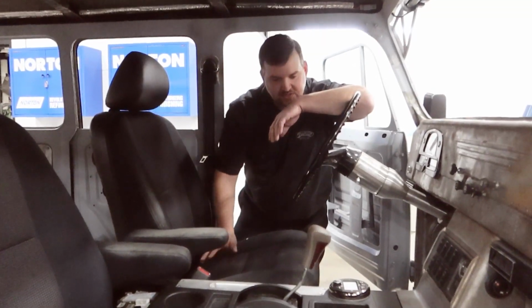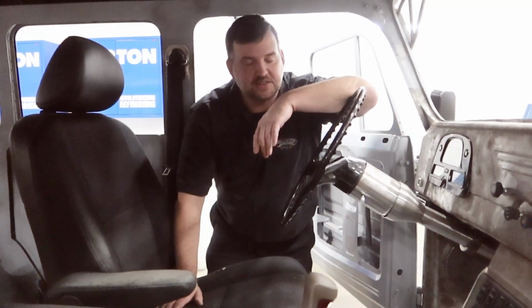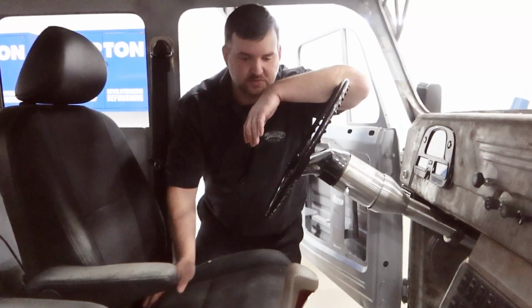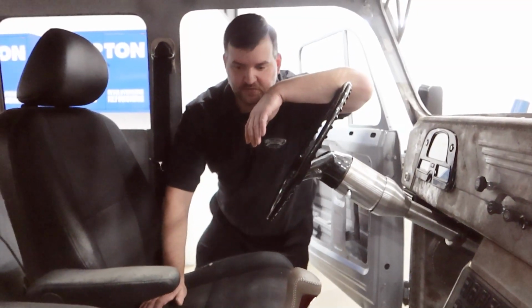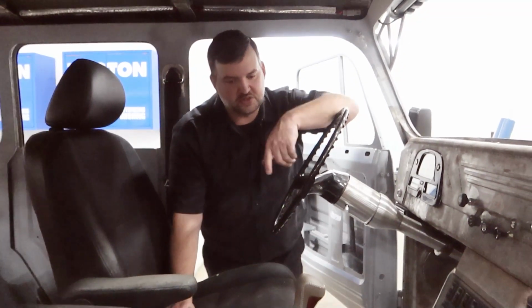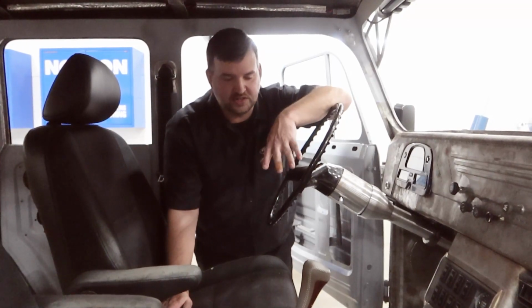Well, in this one situation, we've got 6 different CAN bus networks that all have to still have communication with each other, or at least the majority of them, for other systems to function. So they all talk to each other and wait for the okay from other computers. Of the computers, there were 38 originally. We're down to the 11 essential ones that it needs to run on.